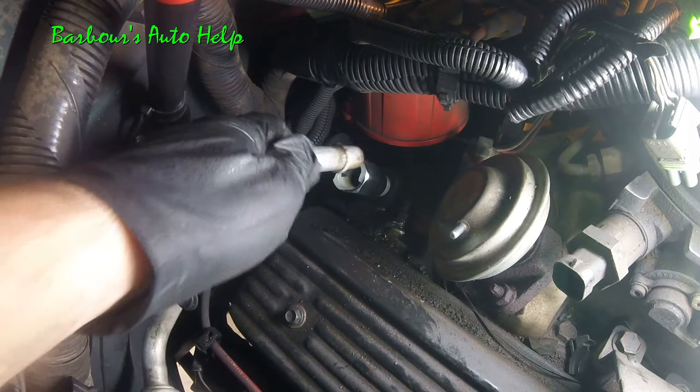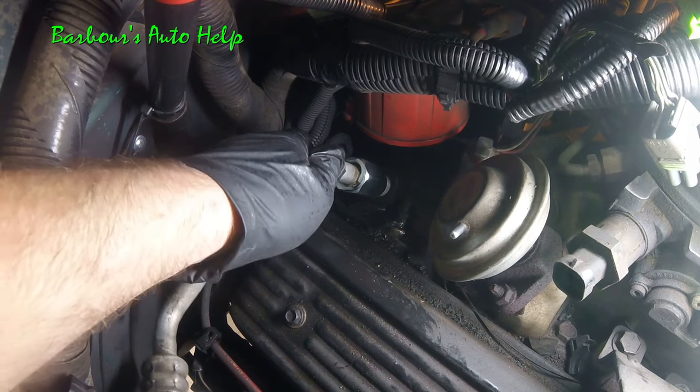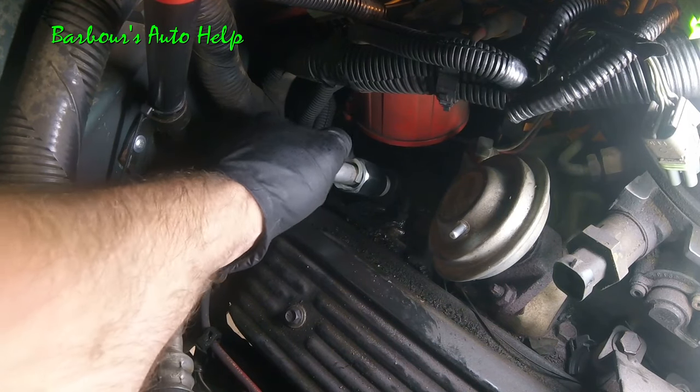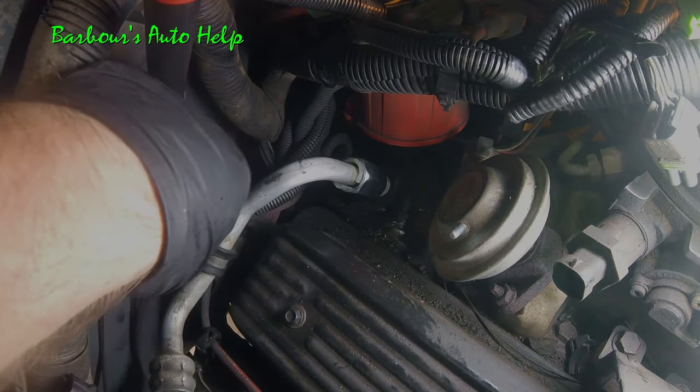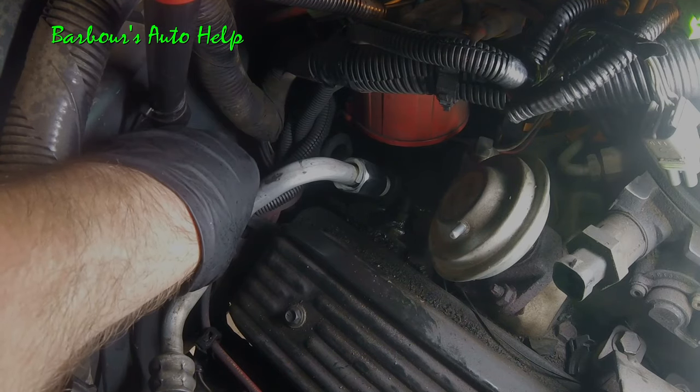If yours has heavy pitting, you may actually need to replace the line that comes out of the outlet. Anyway, let's go ahead and put this right back in there — it should just click right in. There you go, she's in and she's not coming out. Of course you need to put your hose nut back in there so that this thing is going into the intake manifold at the right angle so that it doesn't leak. I do fill and bleed the system afterwards, and you want to pressurize the system to make sure it's not leaking after you do this repair.